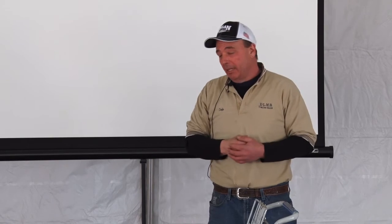GM and Dodge, you leave the inside lights off and you go on a nice 5-hour trail ride and you come back, you load up, click, click, click. My battery's dead. Oh, booger. Everybody's gone. I got my cell phone. Hello, dear. Can you jump start me? Ask me how many times I've done that. Twice. Okay? Because on GM and Ford, that auxiliary power is on all the time, and it will kill your battery. Okay? So now we've got the lights inside working. We know that's good. It's nothing wrong with the truck.